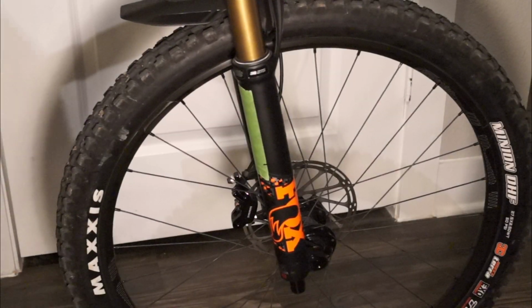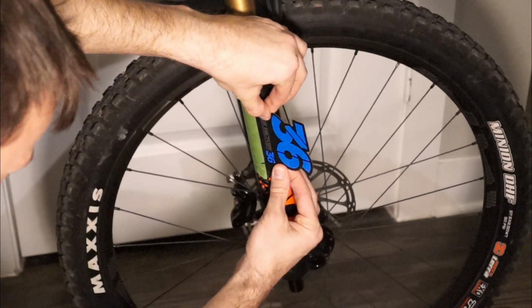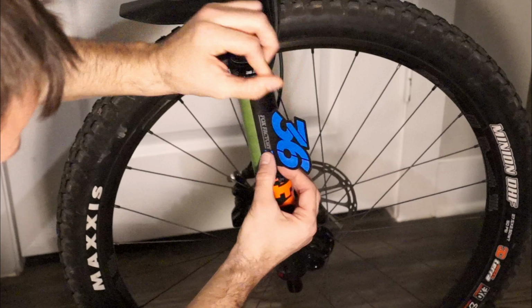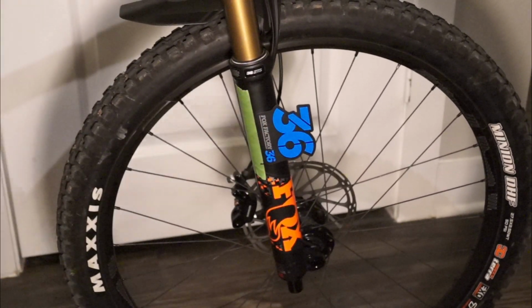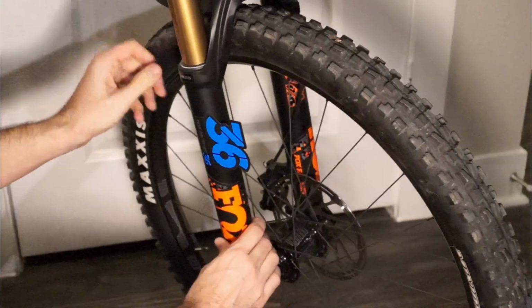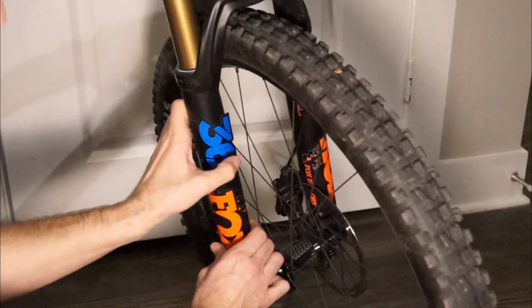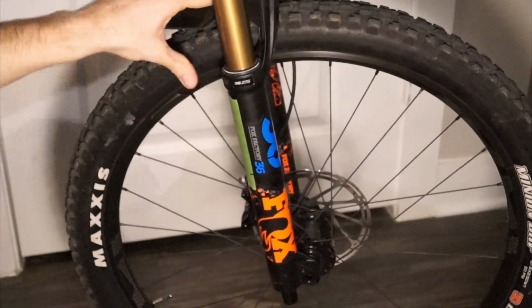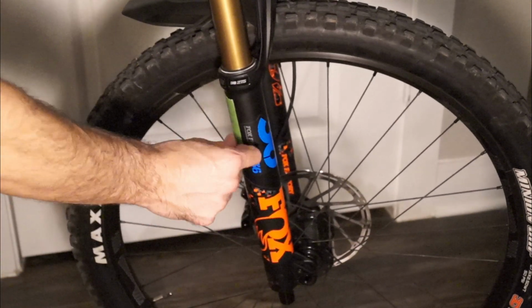Painter's tape is good for creating that straight edge that you see here. So the green, I think it's the Frog brand painter's tape. Whenever I put the painter's tape down, I'll just put a mark where the straight edge and the decal are supposed to line up. That way I can get them back into the factory position where Fox puts them. And then as you're putting the decal down, you want to just place the edge of the decal on your straight edge and then just slowly start working your way around until you have a nice smooth application of the decal.